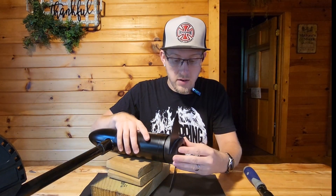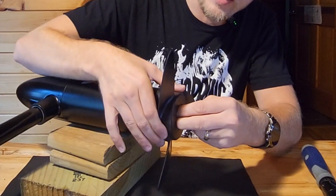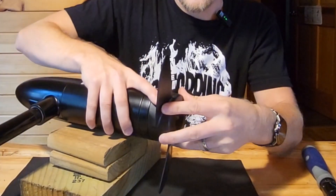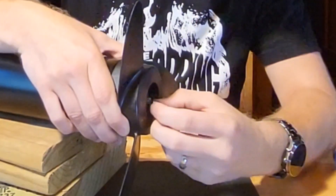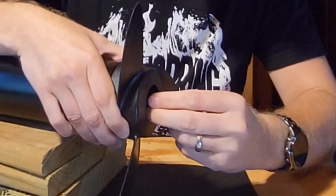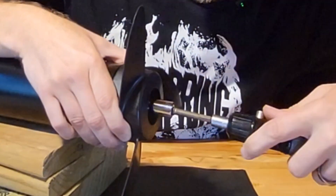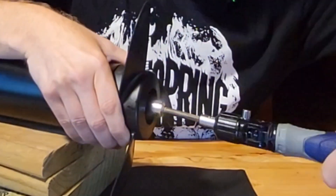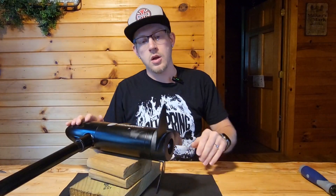We're going to slide it on there. A little tip I have to find the shear pin: you grab the shaft a little, just hold that and wiggle, and you'll feel it slip in there. Remember, you're going to take your washer flush side down — washer on. Then take your nut; it's a little lock nut, so you want to make sure the round part is up. I like to just get it started by hand. On these, you don't need to crazy tighten them — once it's tight, give it a little snug. Good to go.